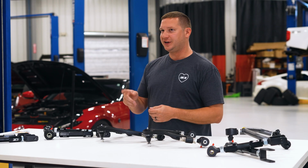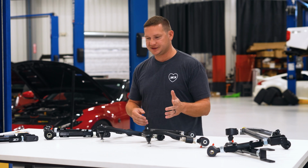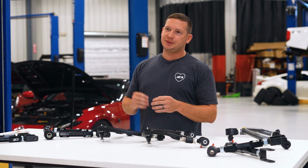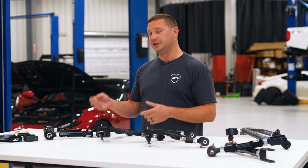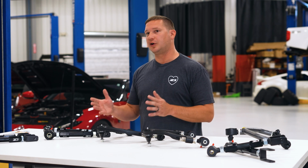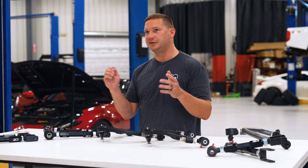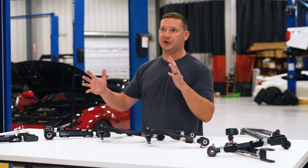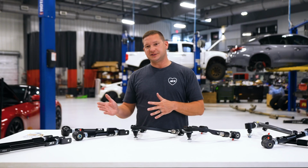Brief talk on the traits of street versus race. We get asked that question about noise versus the performance. Out back, most people don't notice the difference in noise very much on race arms versus the urethane. It is more precise, so if you're pushing the car hard where you feel like you're leaning on the tires in corners and you want the inputs and response of your commands or manipulating the weight of the vehicle to be quicker, more responsive, the race ends are the go-to.